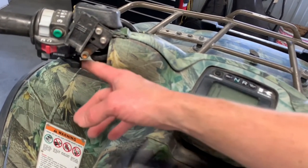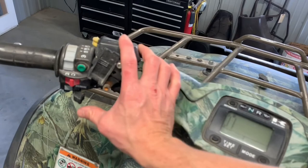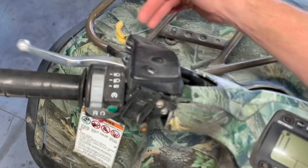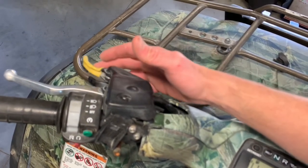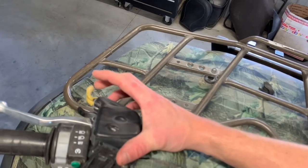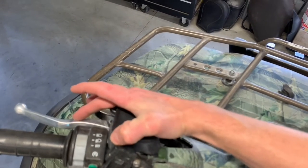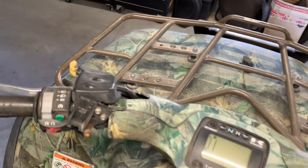On the left-hand side, you've got your choke lever. Pull it completely to the outside to choke the four-wheeler; once it's warmed up, make sure you kick it back to the off position. You've also got a brake lever, a park lever, and a differential lock lever. The differential lock cable runs down to your front differential — pull this yellow lever in and you've got all four wheels spinning. Don't do this while going fast. For the park brake, pull the brake lever in with your left hand, simultaneously pull the little black lever in, then release the brake lever — it'll snap into the park brake position.